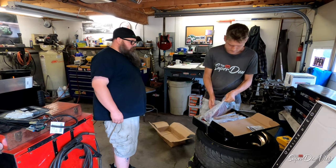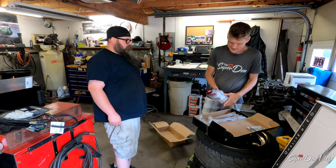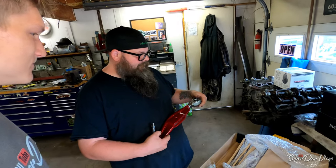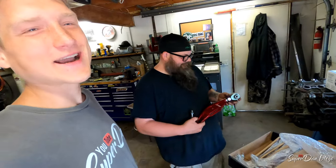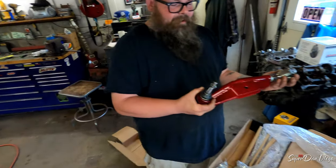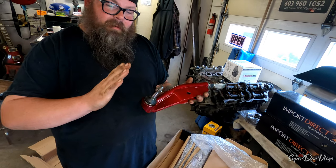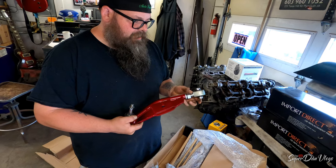Alright, so I have no idea what's what. There's a controller and I'll be the cameraman. So what do you think, Daniel? Depending on how much camber you need, it might actually get broken. No, I'm not going to do that. I have some spacers, so you basically adjust this thing out. This is your ball joint and this attaches to your knuckle, and you loosen this, and this in turn pushes the bottom of your wheel out.